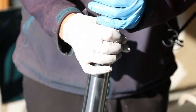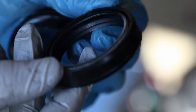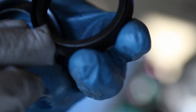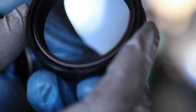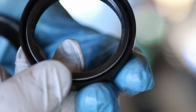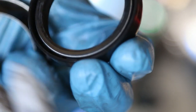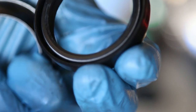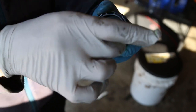The fork assembly is completely done. The top is the smaller version — this is the top part, the part that actually contacts the oil. The bottom is much wider, and the top is the smaller diameter. When you twist it, the wider one is where the oil will be. One of the things I'm going to do is grease it up with waterproof grease and push it into this little groove.